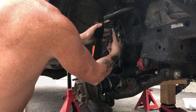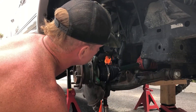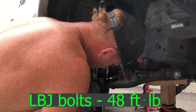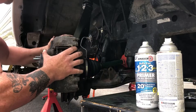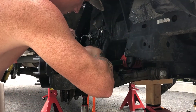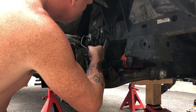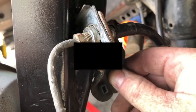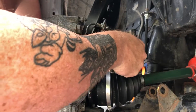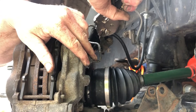We're over halfway there — just put it back together and we're done. The wheel spacer just appeared out of nowhere; I got ahead of myself and put it on before I even put the axle nut on, so I ended up having to take that off and redo it. Here we run into our first issue: this brake line bracket used to live right there, but now the brake line is hitting the spindle gusset. So I found a small bolt and a nut, and I used the nut as a spacer to push that bracket away from the spindle a little bit.